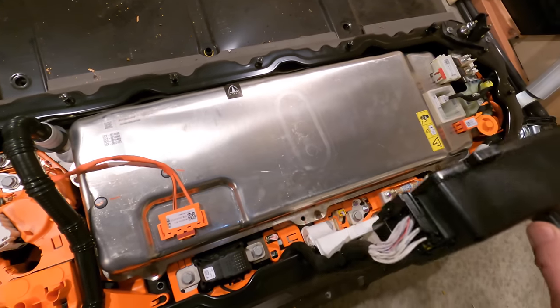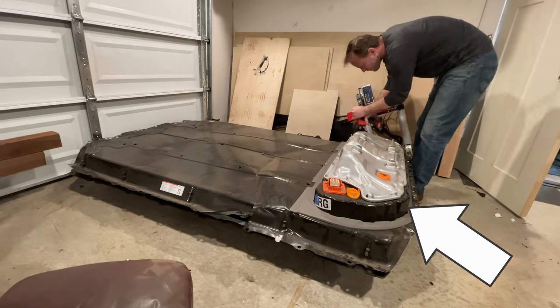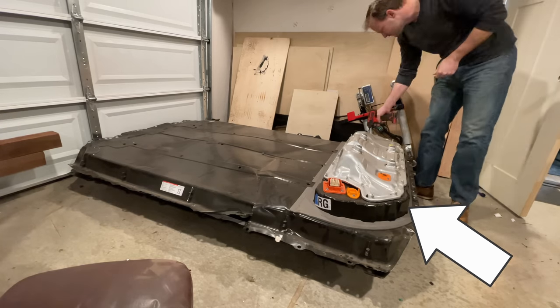You need a DC-DC converter for the low voltage stuff. The Tesla battery has all that stuff up in this part here. This saves a lot of money not having to buy and wire all that stuff together. It's also nice not to have to search through questionable EV equipment. A lot of those parts are either really expensive, or poorly made stuff that will catch on fire, or both.